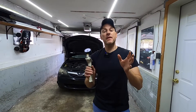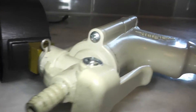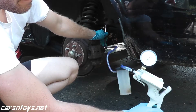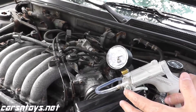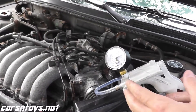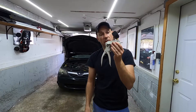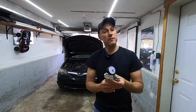Welcome to another episode. Today this is something that many of you may have in your home garage — a vacuum pump. These are terrific if you need to bleed brakes by yourself, test certain valves like an EGR valve. I recently showed how you can check a solenoid valve using a vacuum pump. You can do a lot of nice things with this simple tool, but there is something else you can use it for that can point you in the right direction.